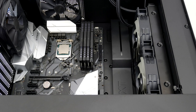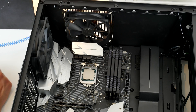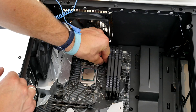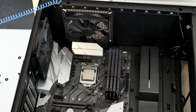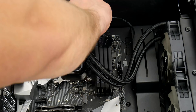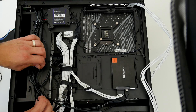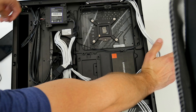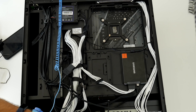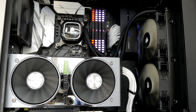Next, put the back plate on, adjust it properly, and then put the standoff screws in. The standoff screws are slightly different depending on whether you're using Intel or AMD, and the manual shows you which ones to use. Then put the thumb screws down, remembering to take the plastic housing off the pump. Round the back, connect the SATA power, tidy up the cables, and you're done. The end result is a nice-looking fan setup and a nice cool CPU that runs fairly quietly and looks awesome.